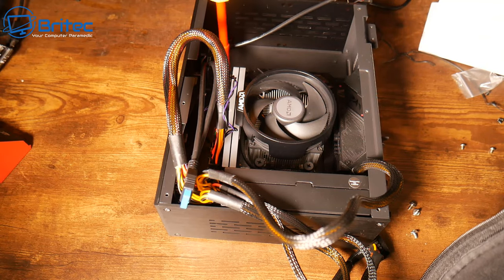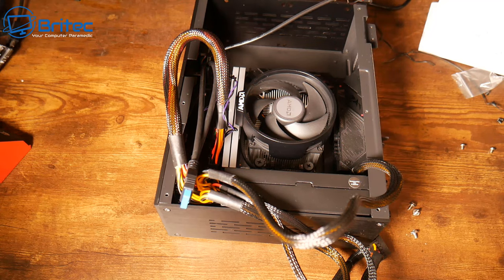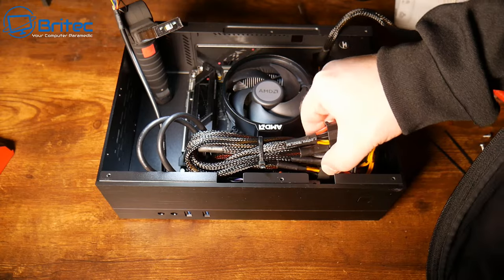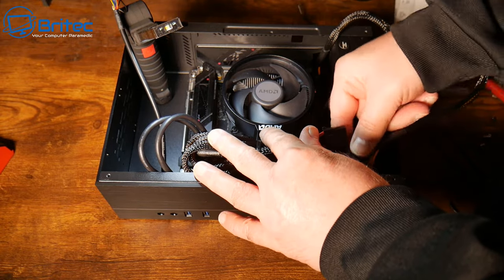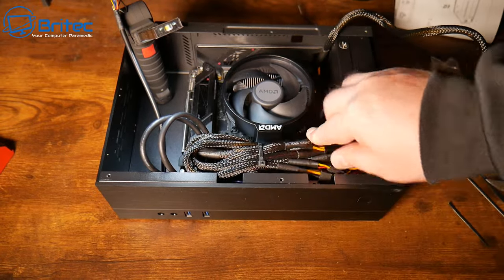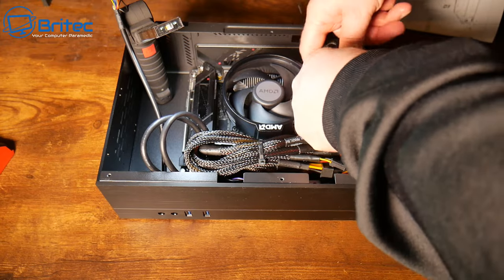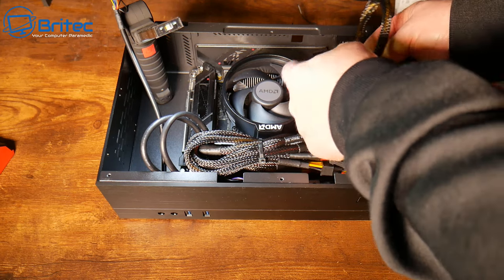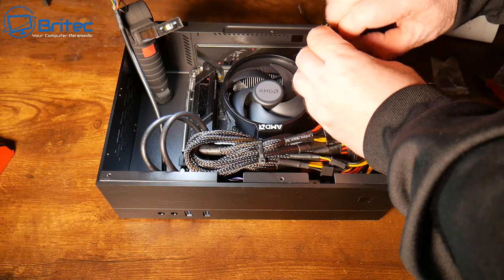It's only your CPU cable and your 24-pin, and that's now done. We've got it all inside the case and now I'm going to screw the motherboard down. I'm hoping we can get all these cables tidied up in here. I've managed to tighten these down and we're going to try and squeeze them in down this side. There is no ventilation at the front so it should be okay. I can tuck this cable down the side, put a cable tie on here and hopefully that should be adequate.